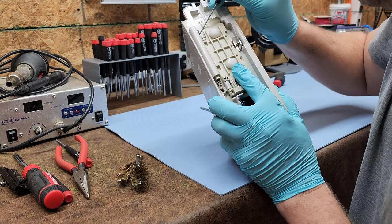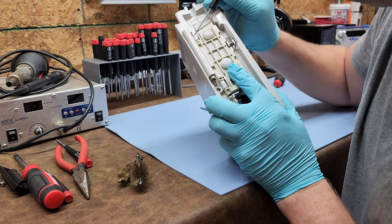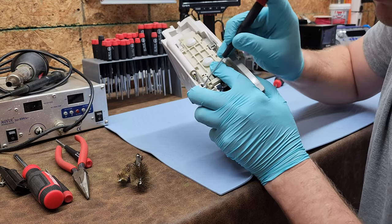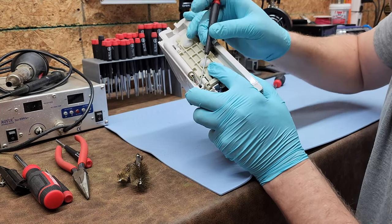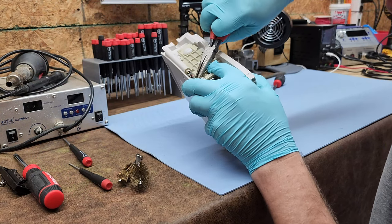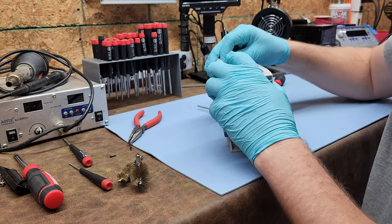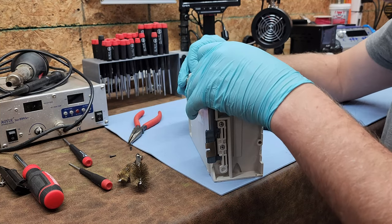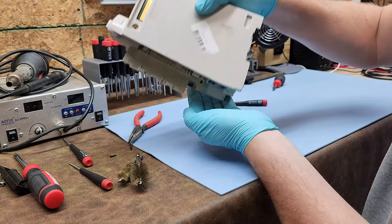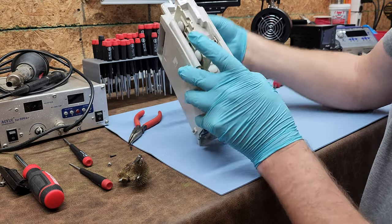There are these little plastic pins that you have to rock out to get them out. I'm just using a little flat blade screwdriver and rocking it, and it pulls it up. Keep some extra plastic pins — I beg you — because something's going to happen where you're going to lose a component and you'll wish you kept one of these little plastic pins. You don't have to remove these completely; you can just pull them up loose. There's one screw on this inner shield, two plastic pins, and now it should come right out.